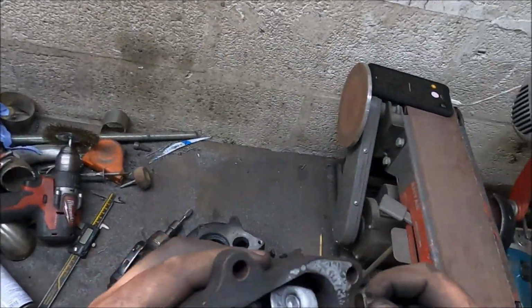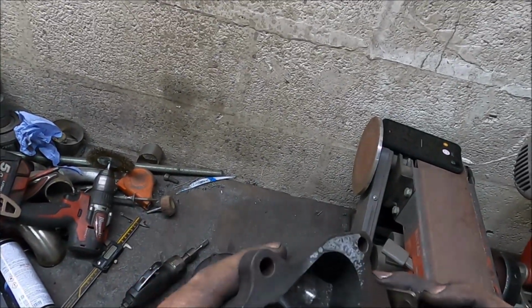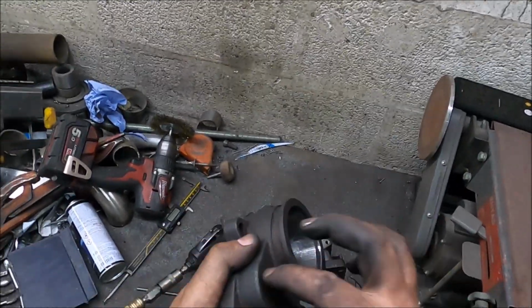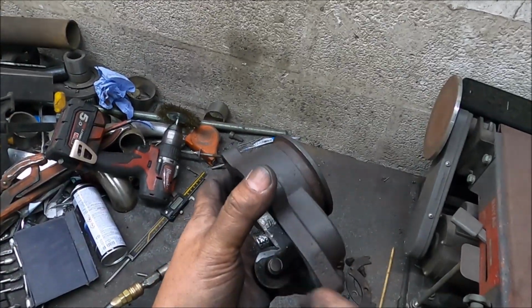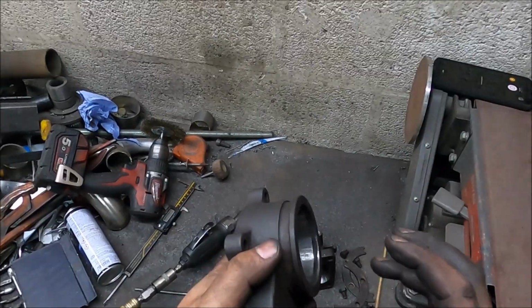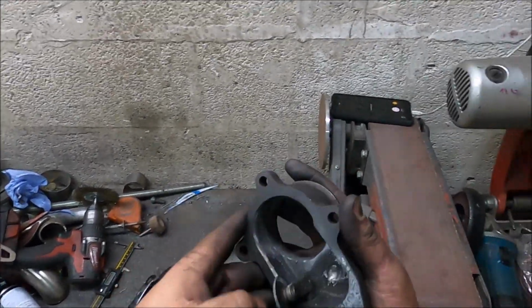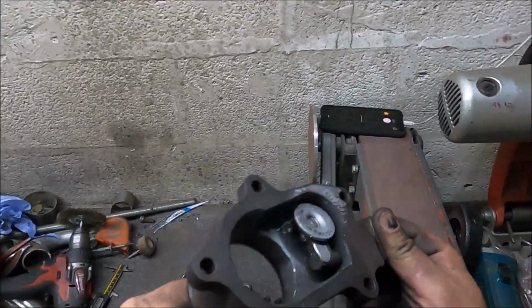This might seem ridiculous overkill, but it's not, because I know of a couple of Borg Warner turbos which are like this as standard. They've got a backing plate and it's got a dent in it to allow the wastegate to sit back more, and they still suffer from creep. So aftermarket conversions of them, they're popular on diesels in America. They use a spacer, like a back plate, to space it out even more to allow the wastegate to open further.